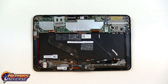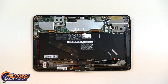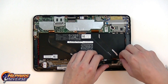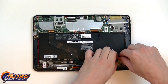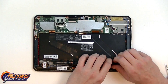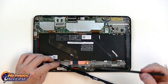Now that we have the motherboard fully exposed we'll be able to release a few clips and a few screws, allowing us to release this screen. On the bottom here we have the slider for the battery. We're going to release both of these small Phillips screws down here, then gently tug and lift away at the spring assisted release. On the far right we're just going to lift up and then push back down for a small clip in the center. We're now able to release that spring and remove the slider.